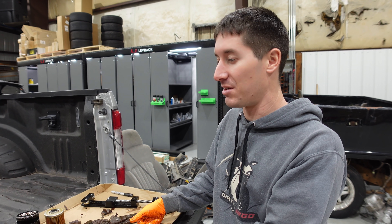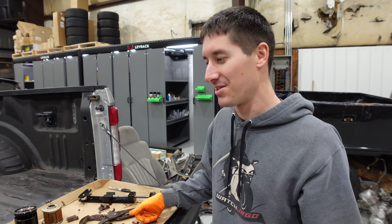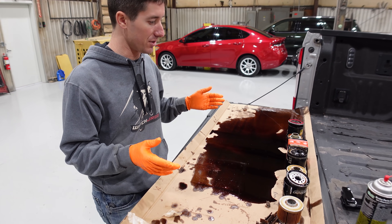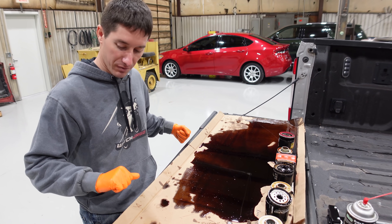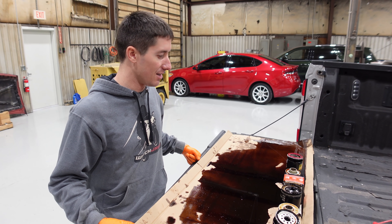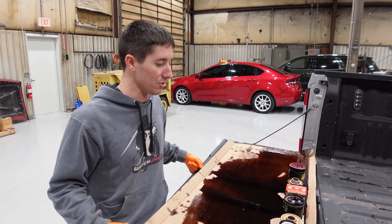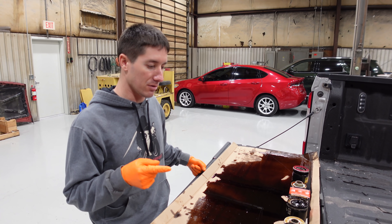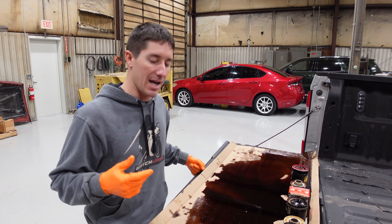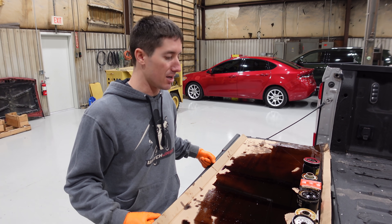As far as why — it's up to you. Maybe you just want to see inside your oil filter, I get it. Cut them open if you want, but first this cutter doesn't work very well, and second it's going to be a gigantic mess. I doubt you're going to ever find a problem that you don't know about either by hearing the engine or by the engine not having oil pressure. Three filters cut open — I'm going to leave it to you guys to make your own decisions. Now there are some use cases for this. A lot of guys that do this are big block drag racers with $25,000 to $35,000 engines, and they're cutting open their filters after every pass or two so they can see if there's damage to the bottom end. That makes sense.